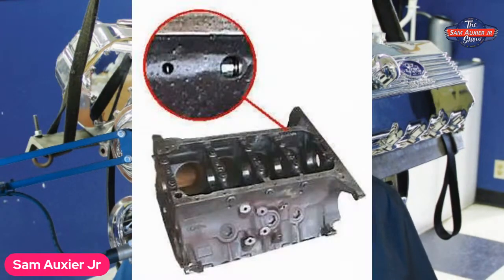So anyway, there's another issue. On a side oiler block, there is a relief valve in the back of the block. And that winds up being straight back. Let me see if I got a picture of it here. Yeah, there it is. Back in the block, there's a relief valve. And of course, that takes out the excess oil past the relief pressure. Now, I personally have never, ever made that valve active.